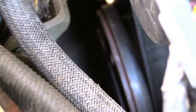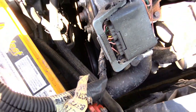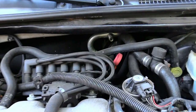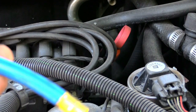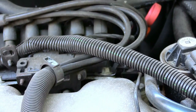The AC compressor is right over here — it's hard to see, but here's your battery and straight down at the very bottom is your AC compressor itself. Once you start your vehicle and the AC compressor is on, connect this end of the pressure gauge onto your low line.